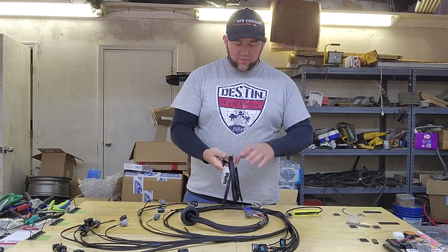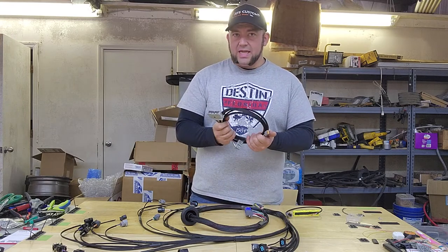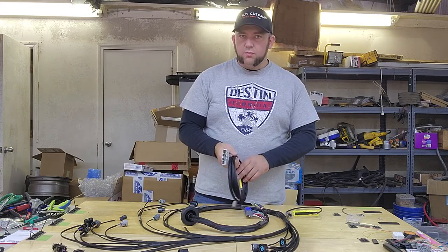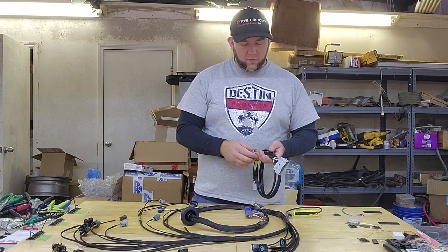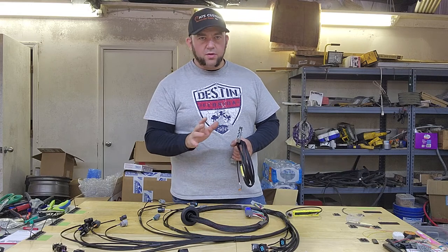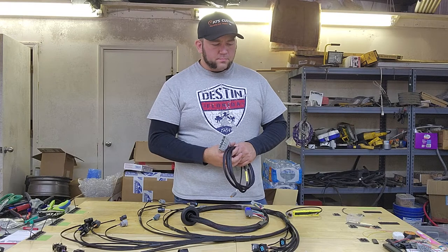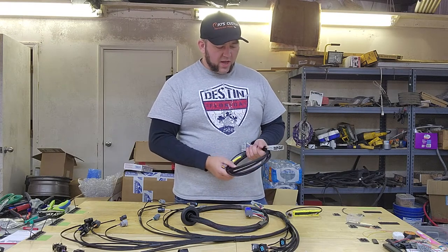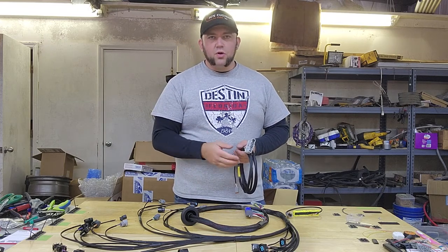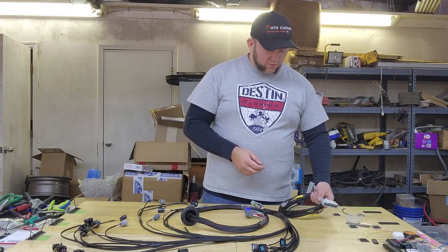It's not very complicated at all. And remember, this is set up for an AEM EMS2 306051. The set up for running an OEM ECU is different — there are a couple of things different. Like, you'll have an OBD2 port, and usually on those I'll leave a couple of wires hanging out so that customers can hook up like a Dakota Digital TAC and speedometer converter.